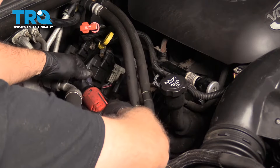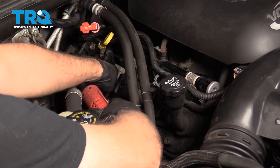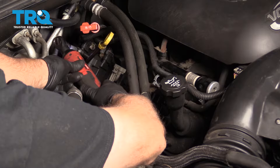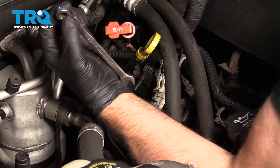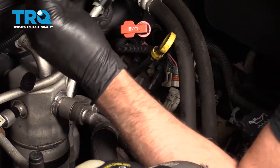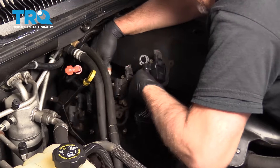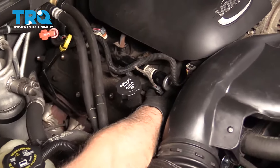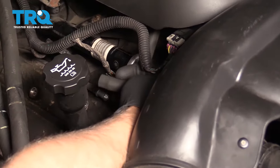One right here. And the last one's not that easy to get to — I'm just gonna use a ratchet wrench, do it by hand. Take that out. Now I can grab this whole coil pack assembly rail and take that right out. And there's a vacuum line that goes to the intake right here — just slide that off.